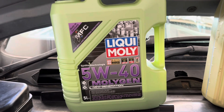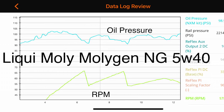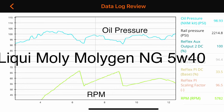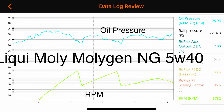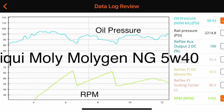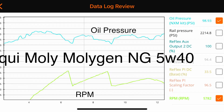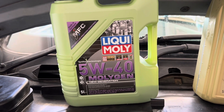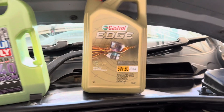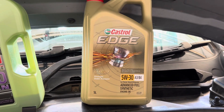On the racetrack — it wasn't fully tuned but was pushing about 75 to 80 percent of final horsepower — what I found with that oil is that I was getting close to exceeding the specification. When you take the 15 psi offset off the data log, it was about 85 to 90 psi on average. That's okay, I could have lived with it, but being at that higher end told me that maybe I could afford to go down a grade to a 5w30.